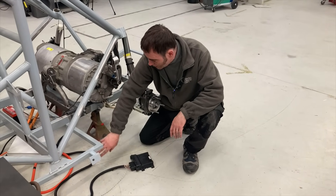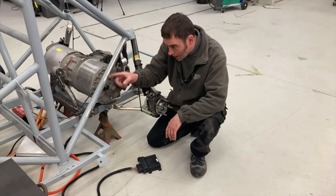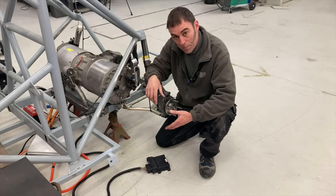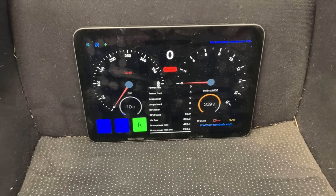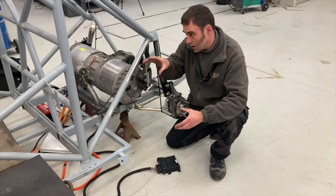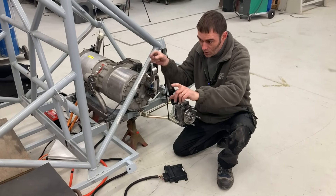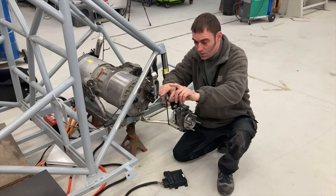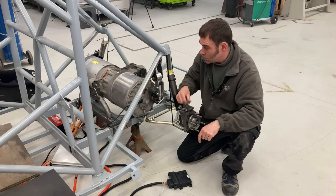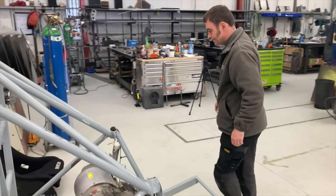Just there is the clever box — this is the EV Controls box itself. It's wired up to the contactors, wired to this motor via CAN, and then from there to the front motor. It can also communicate via Bluetooth to an app on an iPad over there, which shows motor speed, motor temperatures, and lets you change direction. That's not how we'll have it in the car though — we'll use buttons for direction, because reaching around to touch a screen to put it into drive isn't very practical. We'll use the iPad display as just a dashboard display system.